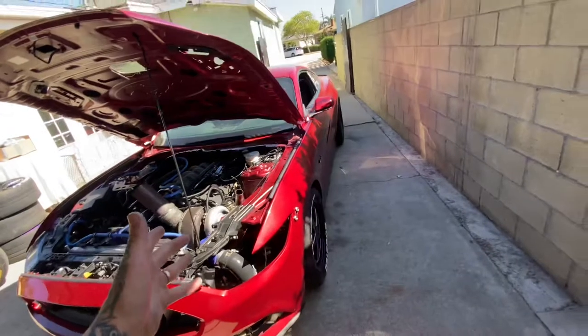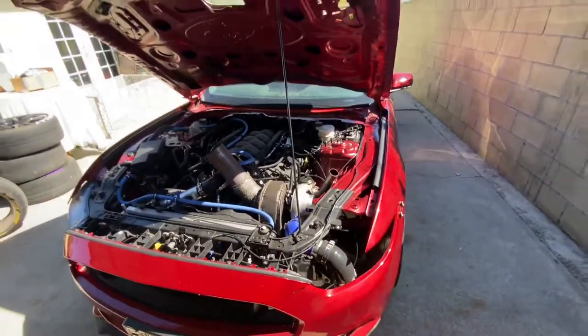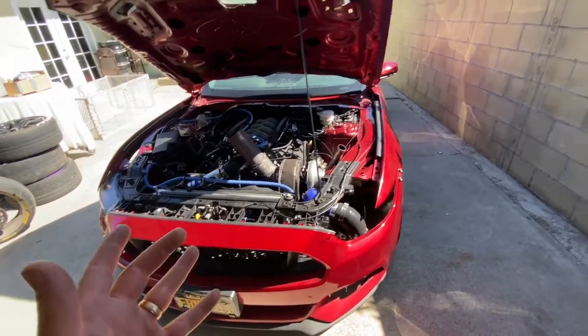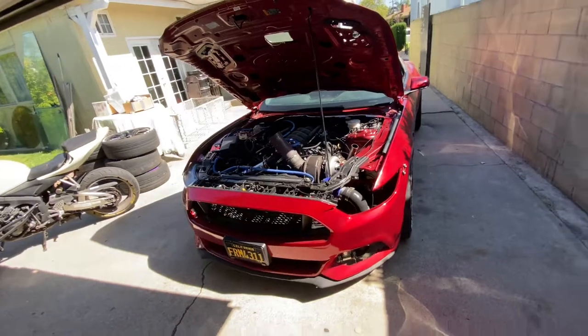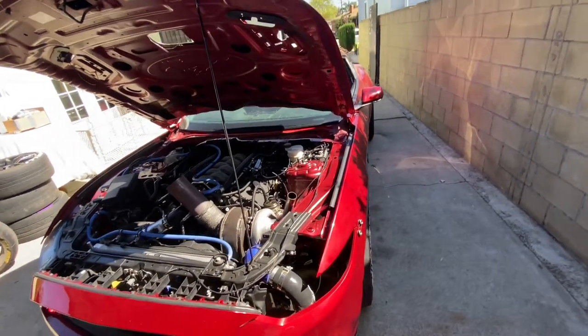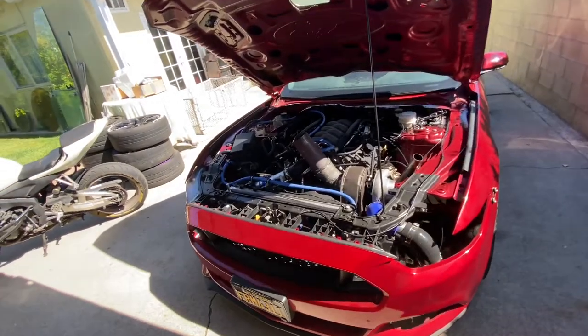I know it's a lot to throw at you guys, but I've been thinking about this for two weeks. Between welding and house work I haven't been able to get out to the Mustang, but now I can. I'm really happy with the results today — I was able to get up on that stall and build up some boost. Even though it was only around 10 psi, at least I'm seeing it build. Everything is going how I wanted. Once I get max overboost to 15 psi, I can set peak boost and then work on gain and sensitivity to help the turbo spool quicker off the line. I was a nitrous guy before this, so it's a whole different kind of setup, but I'm loving this turbo setup.